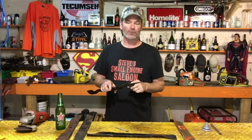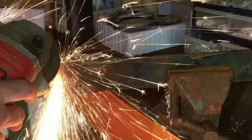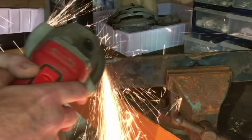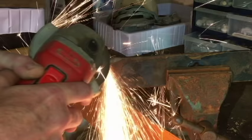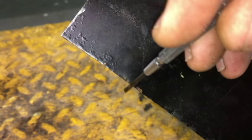The next day you're going to go out on your nice manicured lawn and you're going to see little brown tips all over your grass because they're torn. I'm going to show you a quick demo right now — I'll put this in my vice and use the angle grinder so you can see how I'm actually sharpening it. Keep sharpening at the proper angle, removing as much material as needed, until you look at the bottom side and all those little rock chips and dings are gone and it looks nice and smooth along that cutting edge.